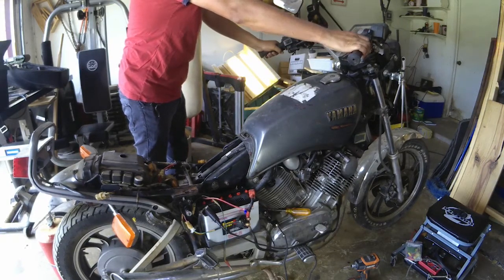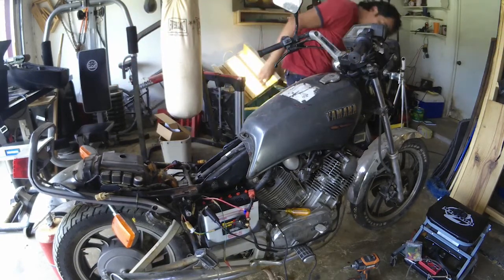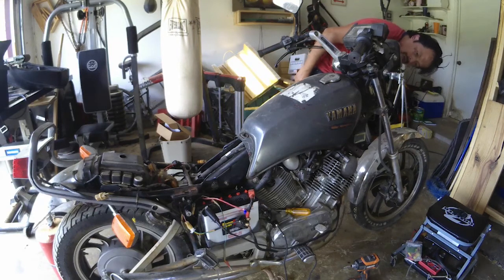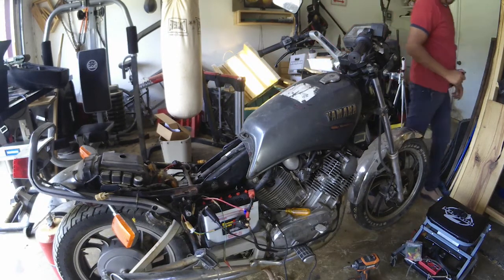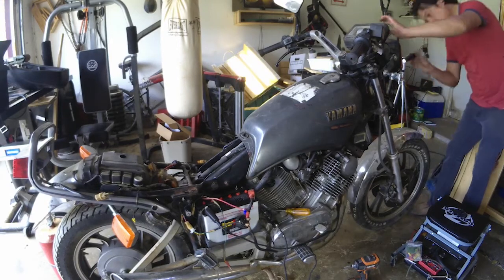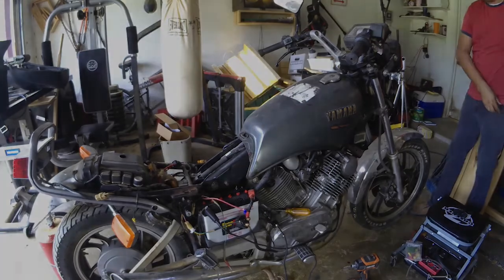That's what they call the box of rocks. So it's a common problem with these Yamahas. Some kind of problem with the starter where the gears do not engage. So one solution is to remove a starter spring that's inside the motor starter components. So I'm going to do that, and hopefully that fixes the starter. So keep an eye out for that next video.